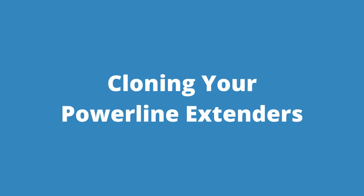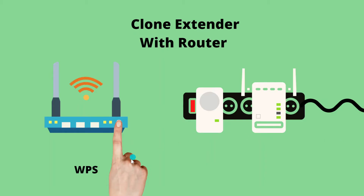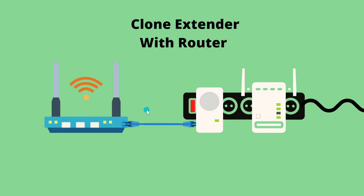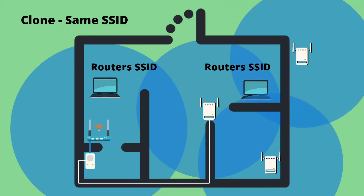To clone the extender with the router, we don't connect the adapter right away. Instead, hit the clone button on the extender and the WPS button on the router. The clone process will copy the settings from the wireless router — such as the SSID and password — over to the extender, putting the Powerline extender on the same wireless network as the router. Once that's done, connect the adapter to a LAN port in the wireless router and plug it into the wall; the adapter will automatically create a connection with the extender. To add additional extenders, simply use the pairing button on the new extender and pair it with either the original extender or the adapter.